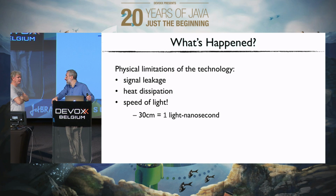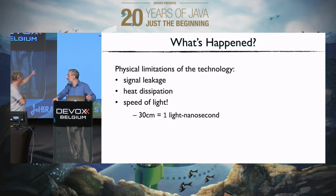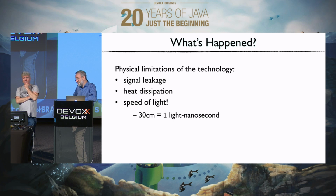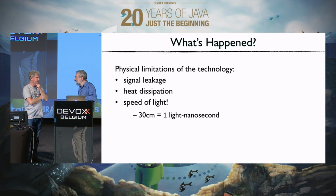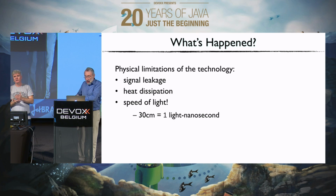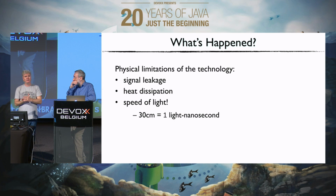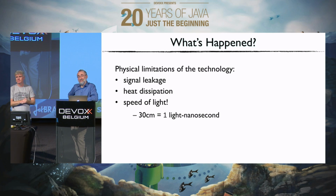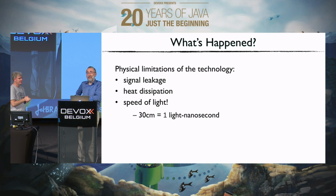Yeah, but they could still keep increasing the clock speeds. They just can't deal with the heat. So we worked with a number of clients that will actually overclock their CPUs, and then they will fix the clock frequency, right? And that works really nicely because that means that your CPU is always hot, always ready to run, and that means you can get really, really fast responses, like in the microsecond range. The only problem is that they have to keep replacing the hardware at a very high frequency because they just burn the chips out really, really fast. So these things might run for a month or two, and then it's basically burnt out, throw it out, put a new one in. Right. Okay. That may not be much of a strategy for the ordinary user.